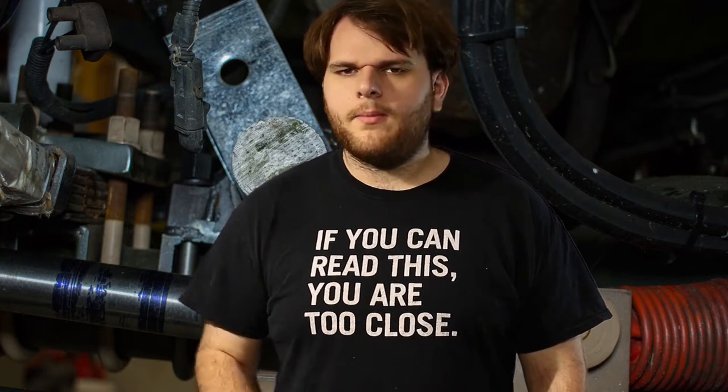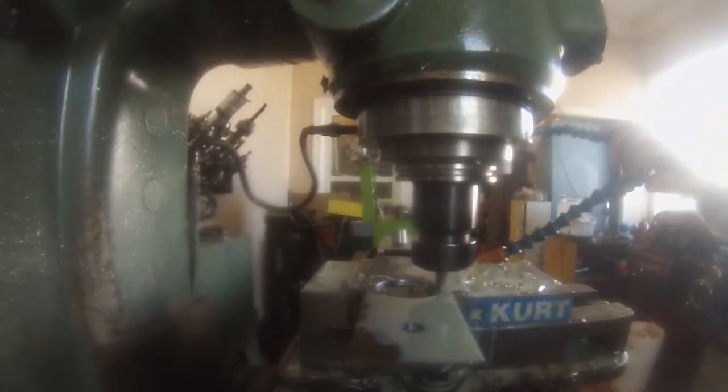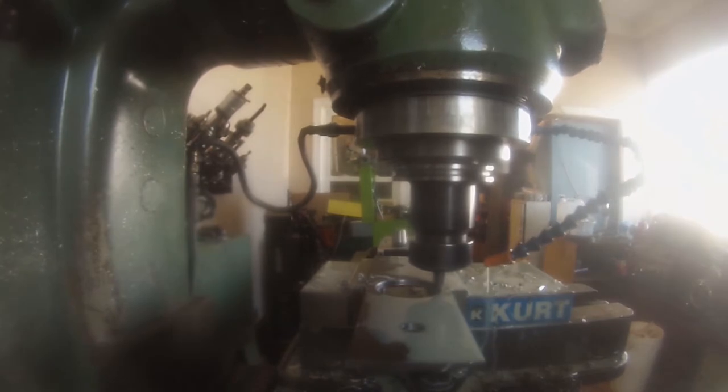I start out by making a template out of some sheet metal. Everything down here is tight. If I make the arm too short, I will run into my leaf spring. Make it too long, I run the risk of hitting something when my suspension is fully compressed. I could also overextend the tie rod end if the Swing Link's arm is too long. The arm may also not be symmetric — the lower half of the arm might be longer or shorter compared to the upper half, depending on where my tires hit my leaf springs. The sheet metal template gives me a pretty good idea on how everything will work, but a good idea is not good enough here.